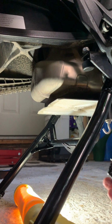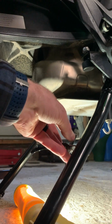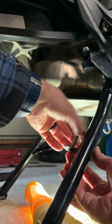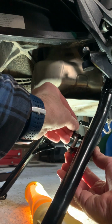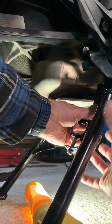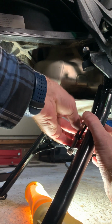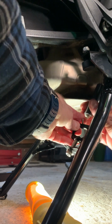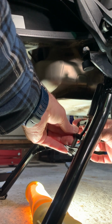All right, KTM Husqvarna has done us nice here. We do not need to screw around with trying to get these springs on with a spring puller. These guys are going to be nice and tight. So we've got our secondary spring plate here. Oh, we are so close. So they are going to make us mess around with that a little bit. That's fine. Not that far to pull it, if you can see. Let's see if I can do it by hand. Probably not. Yeah, not at this angle. I'll grab some pliers. Hold on.